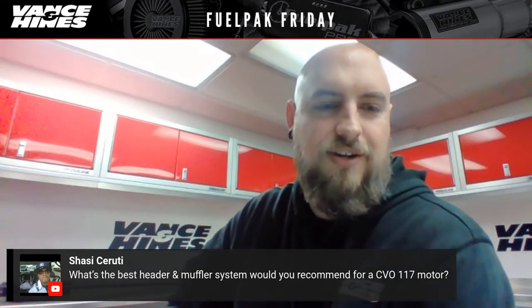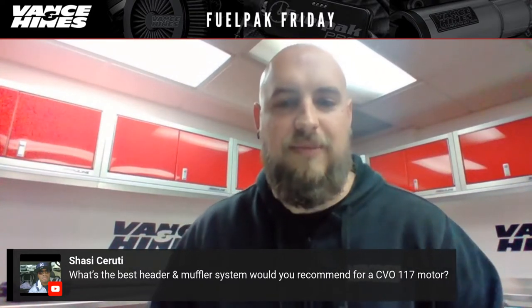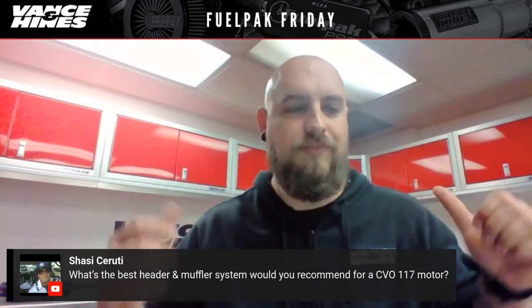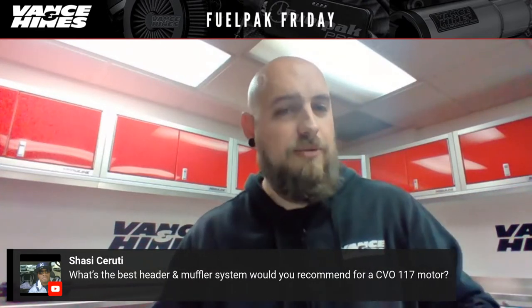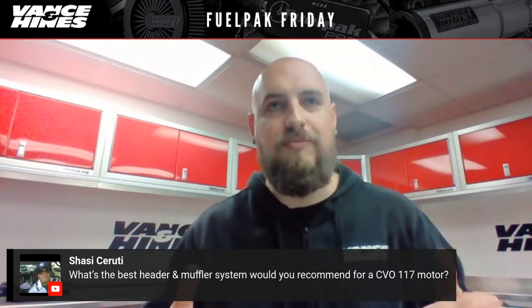Go to Shasti here on YouTube, and I'm going to bounce back to the questions you guys asked on the Instagram stories. What's the best header and muffler system I'd recommend for a CVO 117 motor? That's pretty easy. Two schools of thought. One, if you want to keep the 2-to-1-to-2, if you want to have that rear aesthetic look be symmetrical, and you're dead set on that, then Power Duals and Torquer 450s or High Outputs. Torquer 450s if you want sound. High Outputs if you want a little bit more performance and you want to have it be quieter at idle and quieter while cruising.